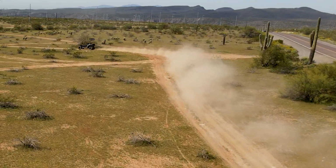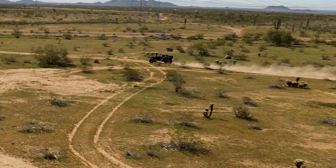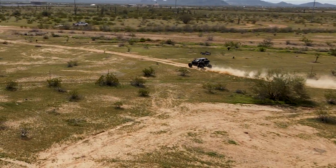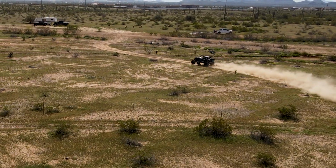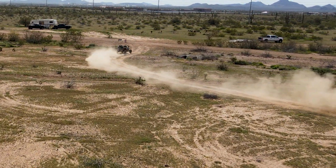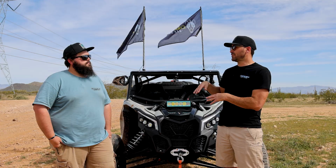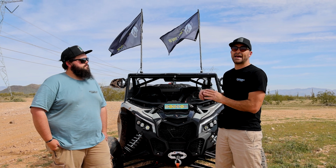We're about 17 and a quarter, 17 and a half. Don't mark me on these ride heights, guys, because I'm running 33s with 17 PSI. MTS Off-Road has some guides for you guys. They like to look at the angle of the CVs. But just so you know, we're about 1 3/4 inches higher in the front. We're 19 and a half.